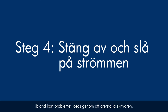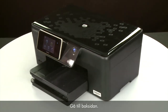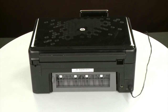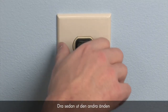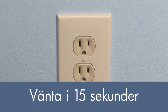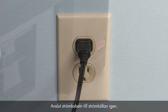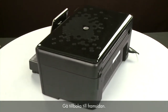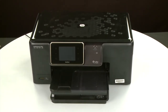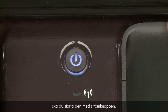Sometimes the issue can be resolved by resetting the printer. The printer must still be on for these steps to work. Turn to the back. While the printer is still powered on, disconnect the power cord from the printer, then disconnect the other end from its power source. Wait 15 seconds — it is important to wait the full 15 seconds to allow the print mechanism to reset. Reconnect the power cord into its power source, then reconnect the other end into the printer. Return to the front. If the printer does not automatically turn on, press the power button to turn on the printer.